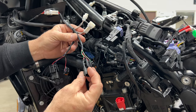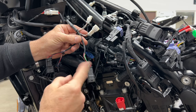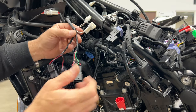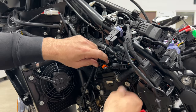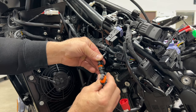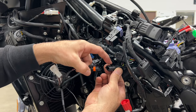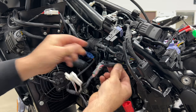First, it doesn't matter which one you plug to the left or right — unlike the fuel injectors, because the coils fire simultaneously all the time, both on intake and exhaust. I wish the instructions said that, but they don't, and this confuses a lot of people. Second, there are no other plugs on this bike that are even close to this, so if you find something these fit, that is it. Third, you can't do them backwards — they're designed with tabs that will not allow that. So our left hand side coil is right here — unplug that, pick a pair, it doesn't matter. If it's wrong it won't go, so flip it around and it goes. You're looking to line up the ramp tab — there's a square one on the other side that isn't correct.